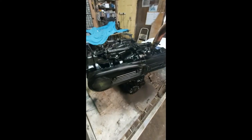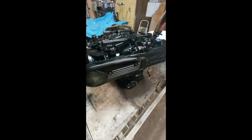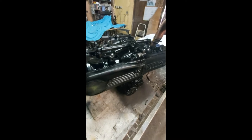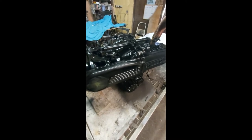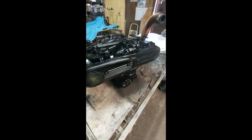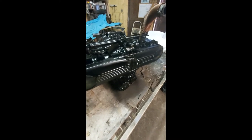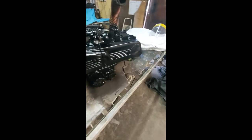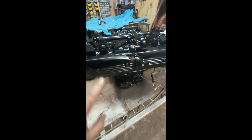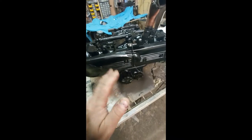That's the second series of black. As you saw in an earlier video, I completely coated the engine first in black, let that set for about three to four minutes, then coated it with orange, let that set for the same four or five minutes, and then went on top of that again with black. The reason I'm doing different colors on top of each other is that I need the paint to react — the orange to mix with the black. The orange will dry faster than the black, so we'll get some cracks here and there which will give it an old effect. I'll come back tomorrow and rub all that down with wet paper when it's completely dry, and what you'll get is a patina of orange coming through the black, then I lacquer the whole lot.